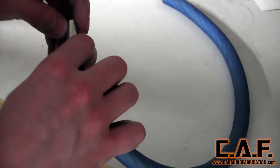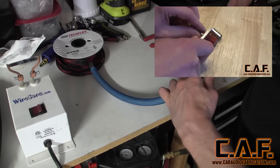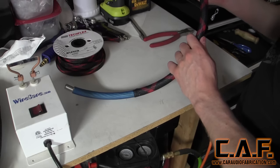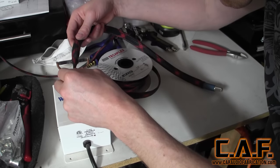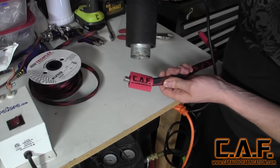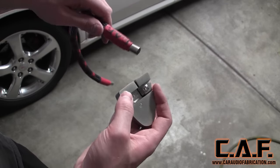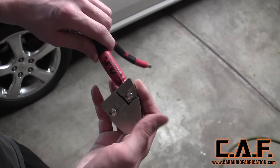For each of the wires, I'm using wire ferrules. For more information about wire ferrules, check out one of our previous videos in the description. With the wire ferrule in place, I apply TechFlex. TechFlex allows me to color code all the wiring throughout the build and also provides an additional level of protection. Once the wire is covered, I use a heat knife to cut it to length. Then to finish prepping the wire, I apply one of my custom Car Audio Fabrication heat shrinks from Wirecare.com. I'll be doing this process for every single wire within this build and it gives us a really clean, nice custom look.